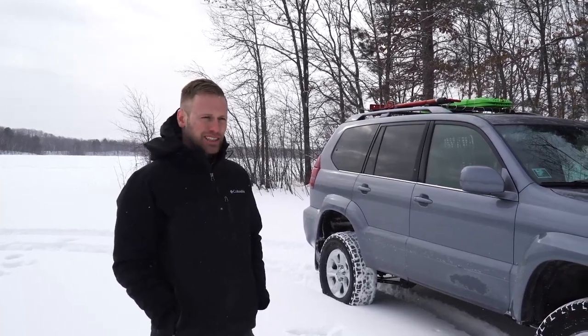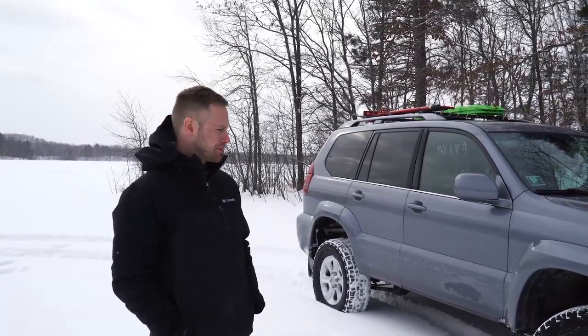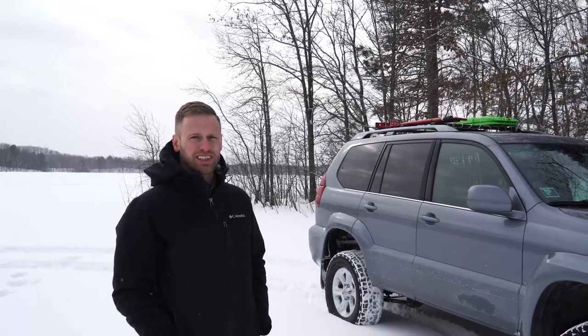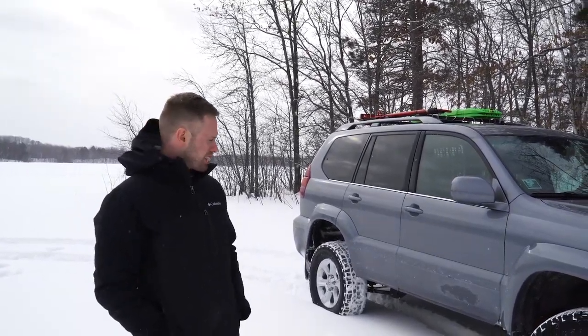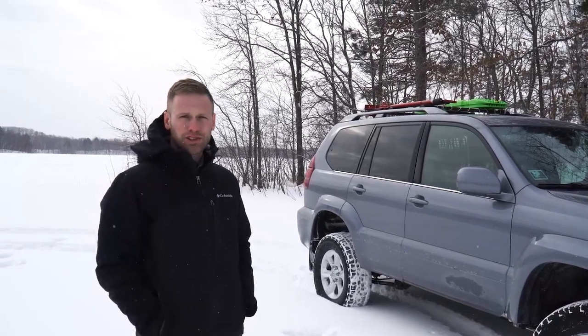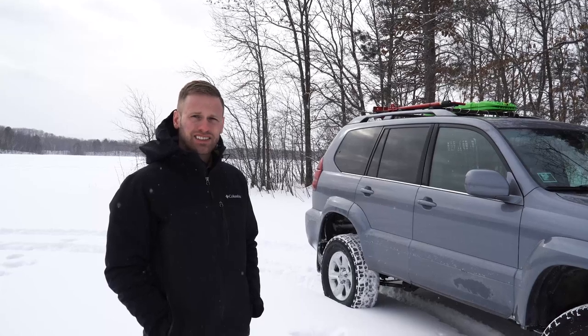Okay. Factory, the vehicle had air suspension, which is kind of a unique thing. So you could lower and raise it, but for reliability's sake, I took it out. Okay. So I have about a 2-inch lift on the front. Stock upper control arms, that'll probably be the next suspension thing to upgrade. Okay, so, very good.